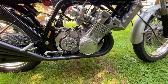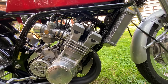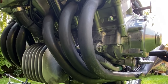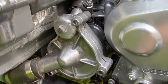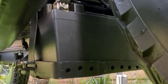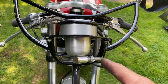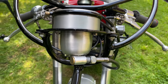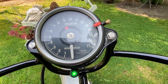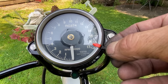Before I replace the fairing, let's have a little walk around the bike and I'll show you some of its features. When I made the frame, I made sure the engine was leaning at the correct angle compared with the standard Honda engine, and also the distance from the crankshaft to the rear wheel was the same. Sitting between the exhaust system is a finned pre-cooler for the radiator, and here's the water pump on the side of the engine. I managed to hide a battery underneath the swinging arm in front of the rear wheel — this is to work the electric starter motor and the points ignition. There's no alternator fitted to charge the battery, but the battery will run the engine for about three hours. I made the electronic rev counter and managed to hide the feed wires inside a hollow drive cable, creating a more authentic look. The red line is fully adjustable, just like the original.